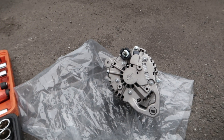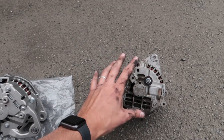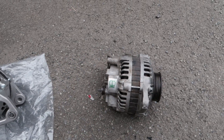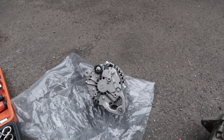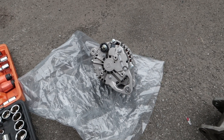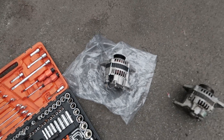This is a much bigger unit. This is probably why it never really worked well. Looking at my Yahoo Auctions purchase history, I found this came off a non-turbo RB20, from an R33 or R34 Skyline — that's probably why it's a much smaller unit with far less amperage output. Also because I did the resistor delete for the fuel pump and we're running directly off a relay from the battery, the fuel pump's running at 100% all the time. Combined with the fan, that's probably what caused it to overheat. In the future I'm doing an LS1 alternator upgrade when we rebuild the Skyline, but this was a cheap solution for now — I have a big road trip on the Skyline this weekend.